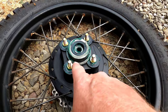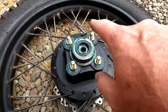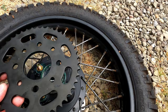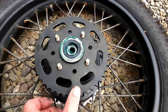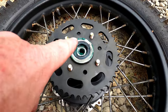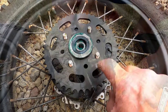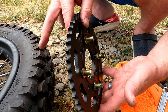Mine looked really good so I didn't bother pulling the bushings out — there are other people that did videos replacing the bushings but mine are good. I cleaned everything up really well and put a little grease in there to preserve everything. Now we're going to put the new sprocket on. There are two different-sized holes — you want the larger holes. There is a flat side on the JT sprocket that faces out, and a ridge side on the other side.